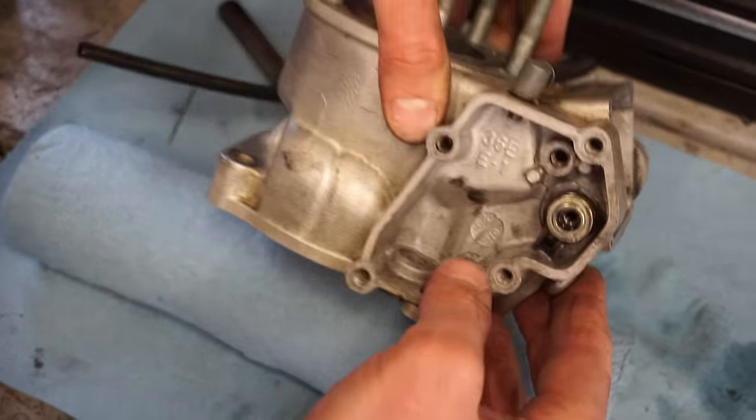All right, we're gonna be using a little ultra black gasket maker on the base gasket. Just a very thin amount on here. Just holds it in place and prevents any leaking at the base gasket. Looks like this was a new stud. Put another bolt on there and tighten those two together.